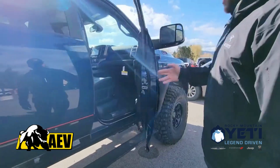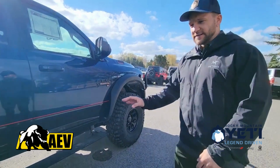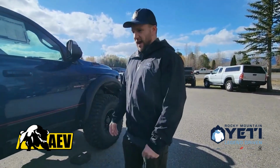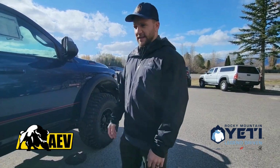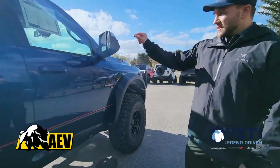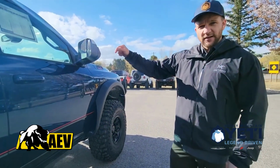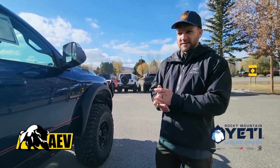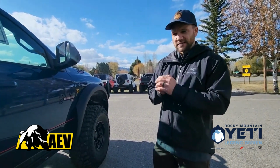No. It's all calibrated and programmed for the tires, so there's no extra switches or buttons. We use the factory aux switches for the lights. There's no learning curve or anything like that to learn to drive the vehicle. The speedometer is accurate. The shift points are accurate. We have a little ProCal to calibrate all that. So it's a diesel truck on 40s. You still get like 17 miles a gallon because the diesel just eats up the tires.